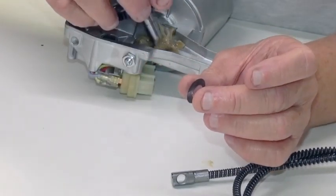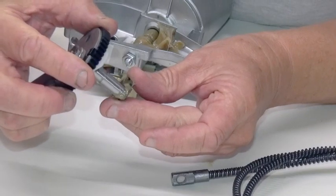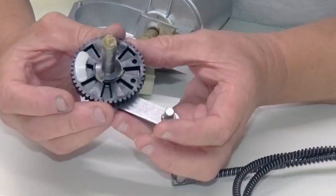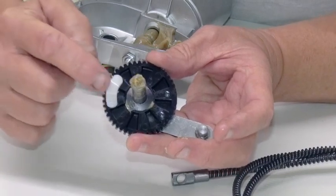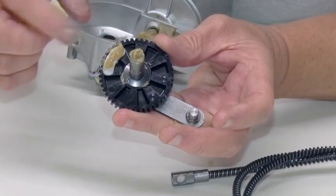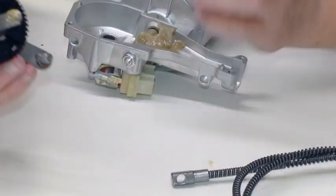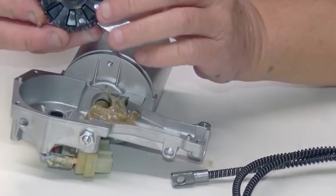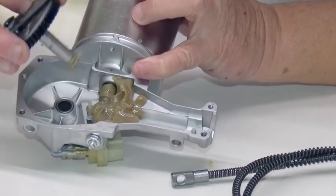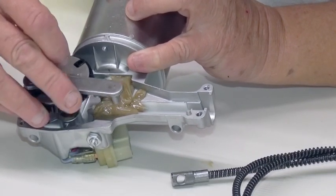Let's get a bit of grease on the washer, spread it around, and slide the washer over the shaft. We can also put a little bit of grease on the slipper plate so it's greased when it actuates the parking switch. We're now going to slide the gear down into the bearing — a little bit more grease on it. Just put it into the top of the bearing for now so it's located, going in about 10mm.